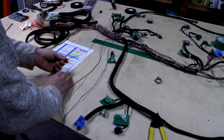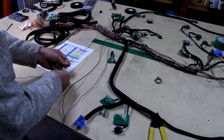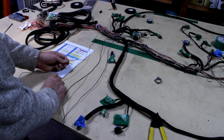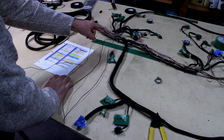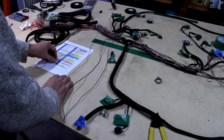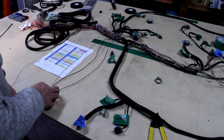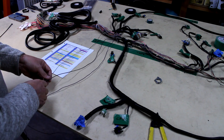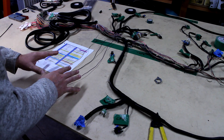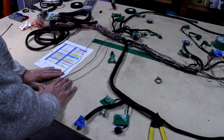The key is this has got to go back into the PCM connector — I just don't know which pin. I've got a call out to Brandon at lt1swap.com; I've explained the situation and I'm sure he'll get back to me. Once I figure out where it goes, I'll clip off the wire where it used to come down to the transmission and just run this back over to get my temperature sensor reconnected. Not all projects go exactly as planned, but that's the easy troubleshooting you sometimes have to do.